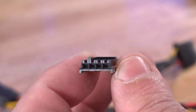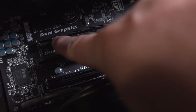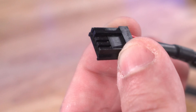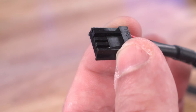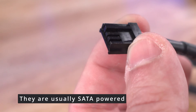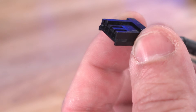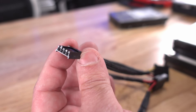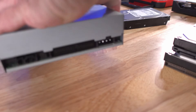There is also generally a 4-pin floppy connection on the cable, though these really aren't used much anymore. Older PCI sound cards — PCI, not PCIe — needed these, as did older USB or FireWire cards. Some newer USB 3.0, 3.1, or USB Type-C expansion cards may still need it for additional power beyond what the PCIe slot provides. These were originally for 3.5-inch or 5.25-inch floppy drives.